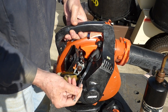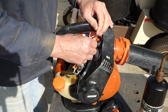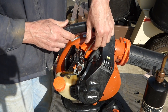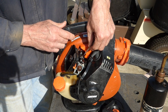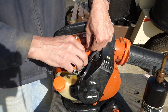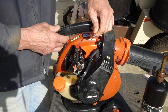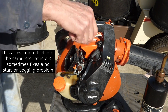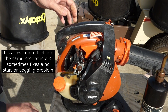Now there's just a flat head screw in there, and I'm going to back it off counter-clockwise — maybe a quarter turn. I want to feel it lock in down there. There, I can feel it locked in. And I'm going to open it up a quarter turn — quarter turn counter-clockwise. Now let's try to start it.